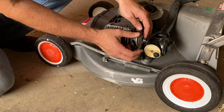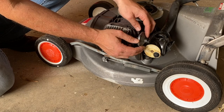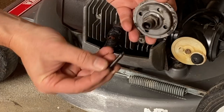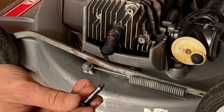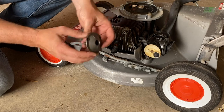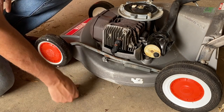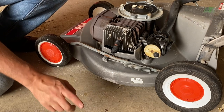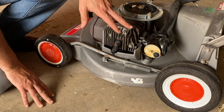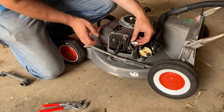I just want to check the function because it seems strange that O-ring was there and the vacuum line was coming loose. Straight away I can see that this little poppet is wanting to come out, and you can actually see the end is broken off it - it should be held in and you should be able to look in this end and see the diaphragm with a little clip on it. That's broken, so that's probably going to cause an issue even starting it. What I'll do is pop a spark plug in there for the moment - that'll give it really strong compression, it'll be harder to pull, but we should be able to get it running anyway.